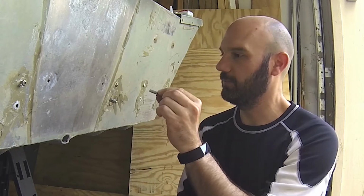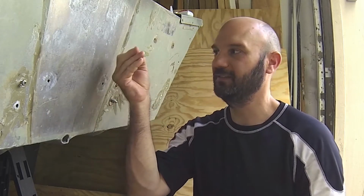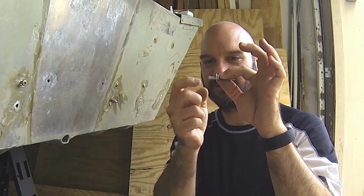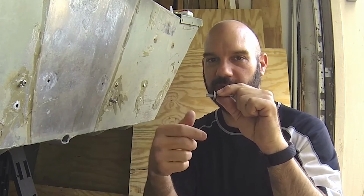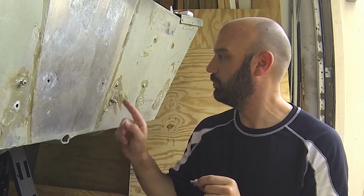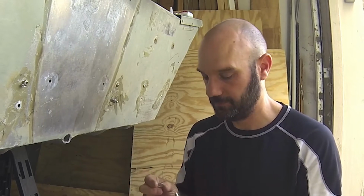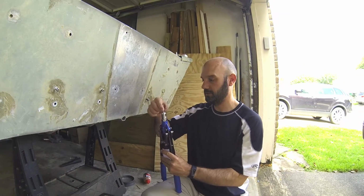What we're going to do is put this side of the rivet on the outside of the boat, and on the inside we can put the washer. This is going to get crushed down and cinch against the washer. It's going to have 3M sealant all over it, watertight and secure as could be. And again, these are just bolts that I have in place that are holding everything in so we can get the rivets in. All right, let us do this.